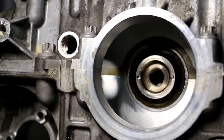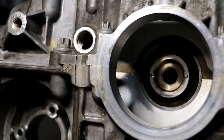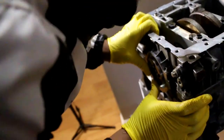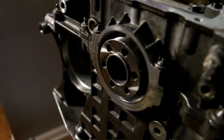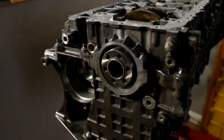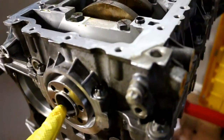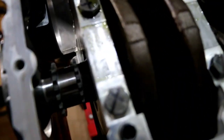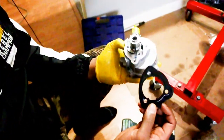Now you guys can see the two holes in the crankshaft for the pins to align into. The hub is holding in there just by the pins — I didn't even put the bolt in yet — just trying to make sure the depth is right so that when you tighten the bolt it's not binding against the crankshaft because it's too shallow.